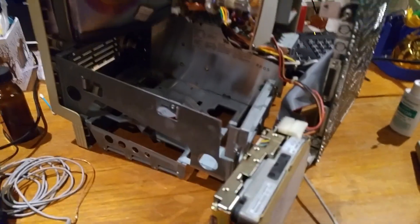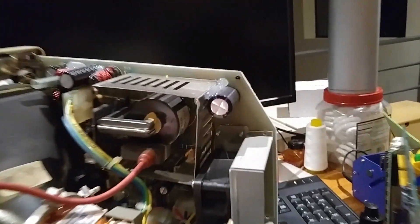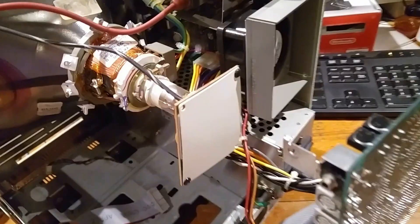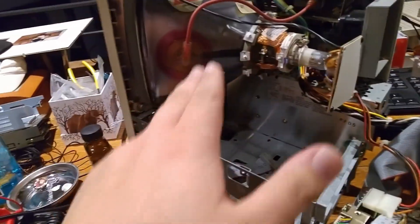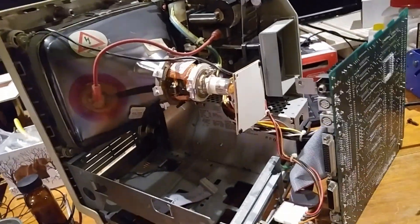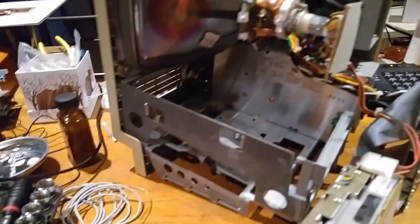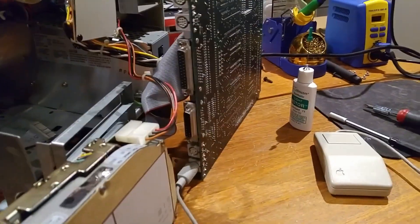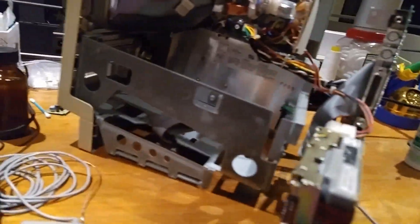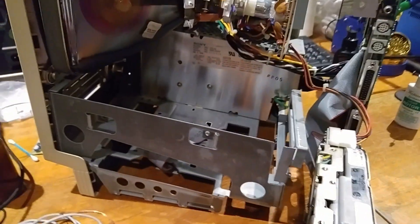It's good to see that this machine boots up again, because it was making me sad that it didn't boot up. While reassembling this, be extremely careful about the CRT and the entire analog board — I just try to keep away from that. I don't want to bridge out these capacitors, and I'm doing it with somebody just over the wall from there so they can do CPR if I hurt myself. Anyway, that's that — I'm going to do a few more power cycles before I call it good, and that method seemed to work.